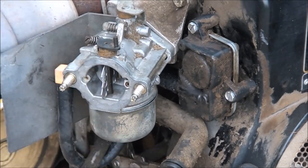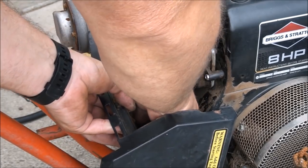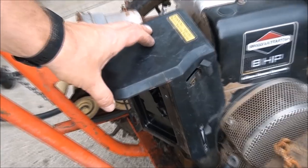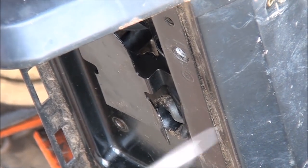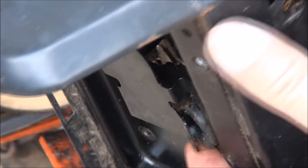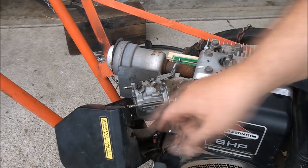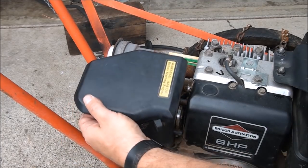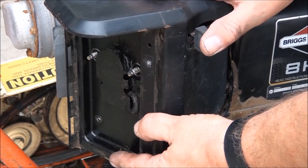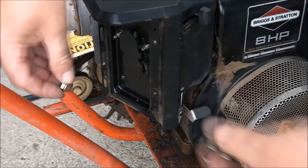The best way to do it is usually to put this on first — it can be kind of tricky but it can be done. You just have to poke it through the hole there and work it back into place. I just use my screwdriver and poke that little sucker through. When you put this piece back on, you want to make sure that this choke lever lines up so when you flip it, it moves that — it turns on your choke. If you look inside here you can see your choke plate moving back and forth, so it's activating. Now you can put it over the carburetor bolt and put your nuts back on.